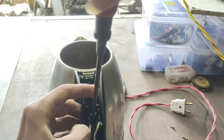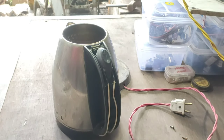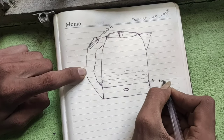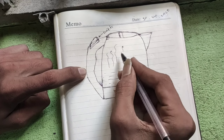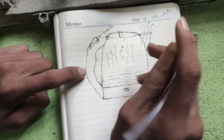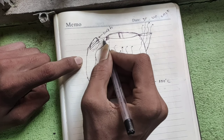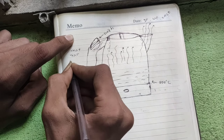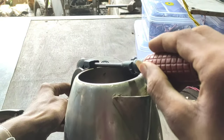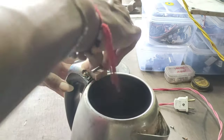It doesn't have contact with the metal body, but it can still heat up and turn off the switch, because the company did some pretty smart work here. In this diagram, let's suppose the kettle is filled with water and when the water reaches 100 degrees Celsius it starts boiling. The water turns into steam, and because steam always tries to move up, some of it escapes from the pouring side of the kettle. But the smart thing is that the same steam is forced to go inside the handle through a path in the handle. The hot steam heats up the metal piece in the switch and turns off power to the heating element. This piece redirects the hot steam from inside the kettle to the switch, and along with the covering plastic piece, that is how all the magic happens.